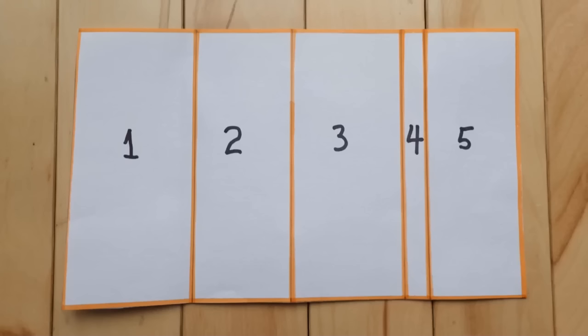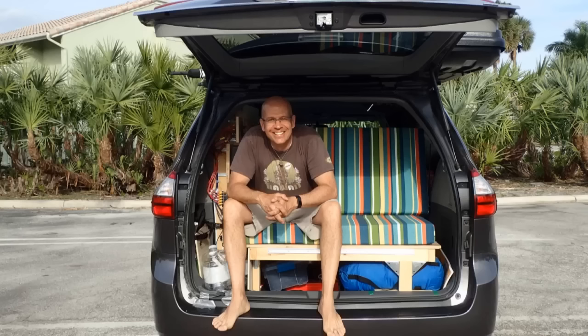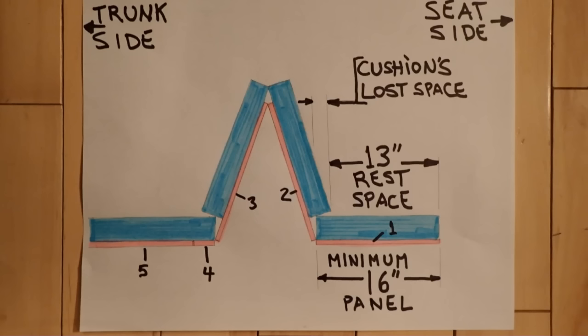The first thing to build is the panel assembly. After deciding the bed size that you need, you have to decide the size of each panel. The only panel that you really have to consider a minimum size for is the sitting panel, which is panel number 1 — I will not recommend going smaller than 16 inches. That minimum exists because you have to take into account the size of the mattress that will be on your back when you are sitting. If you want to sit at the back of the van, the same rule applies for sitting panels number 4 and 5 — minimum 16 inches for both total. All other panels can have the size that fits your needs. I suggest you have your plywood cut at the hardware store. Those long cuts need to be perfect for the piano hinges, and for a few dollars they'll be perfect and easier to bring back home.